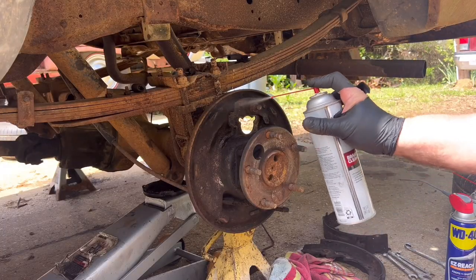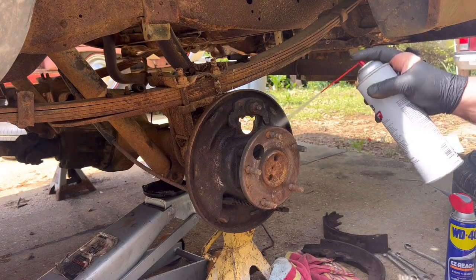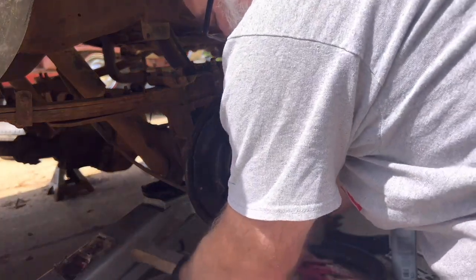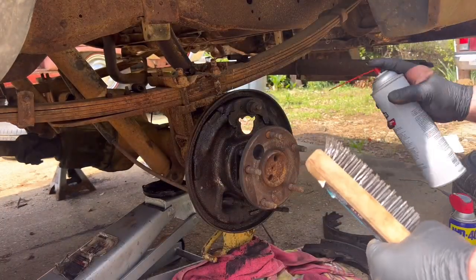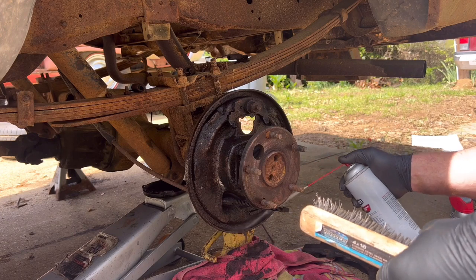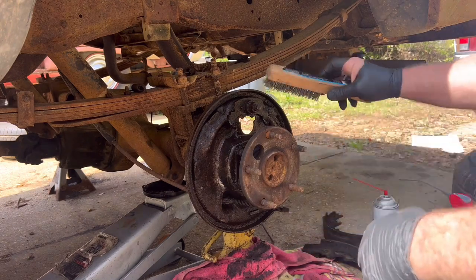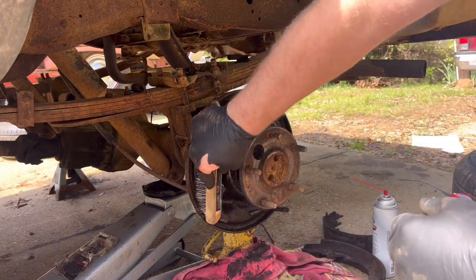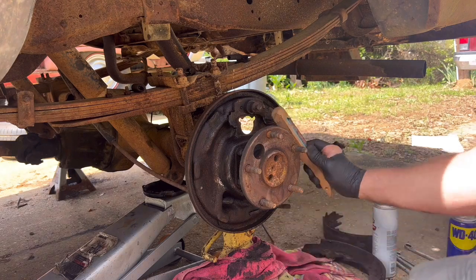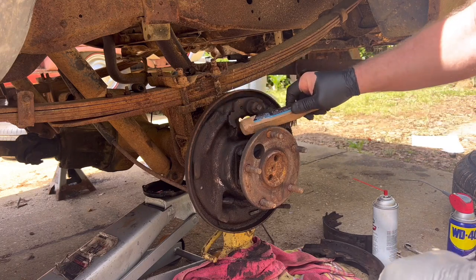Can of brake clean. I'm gonna finish emptying this can. Pretty much done. Wet everything down. Try to catch it on my towel if at all possible. Keep it off my driveway. Again, guys, this is brake dust. Try not to make dust with it. I'm making mud with mine. We're just trying to get the big chunks off. Not doing a restoration here. Just trying to make sure it's clean so that they function properly.